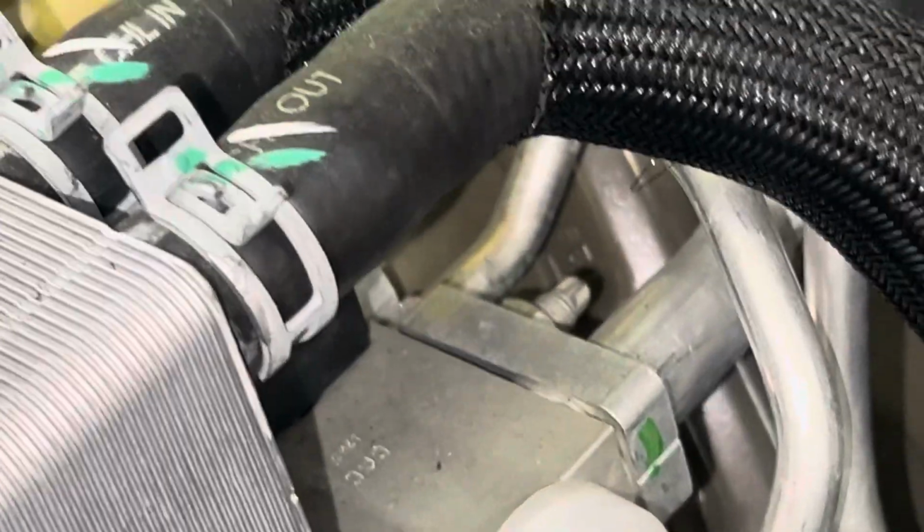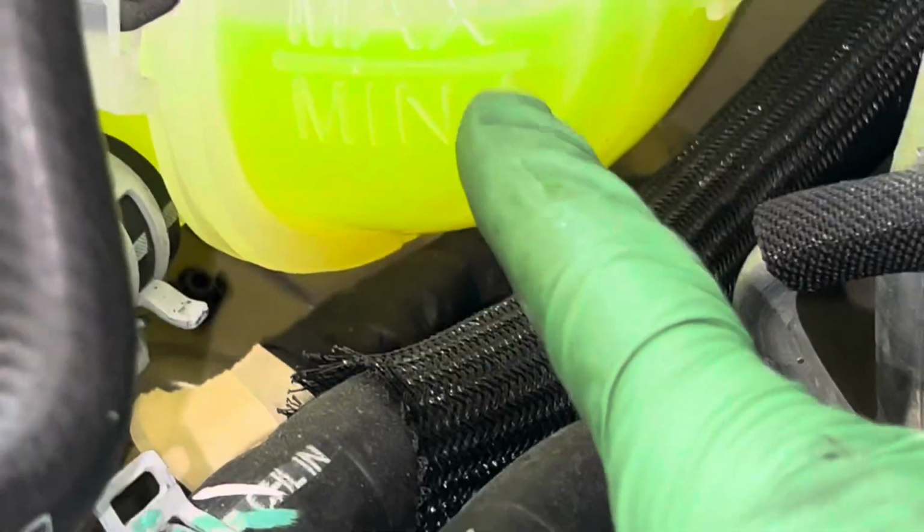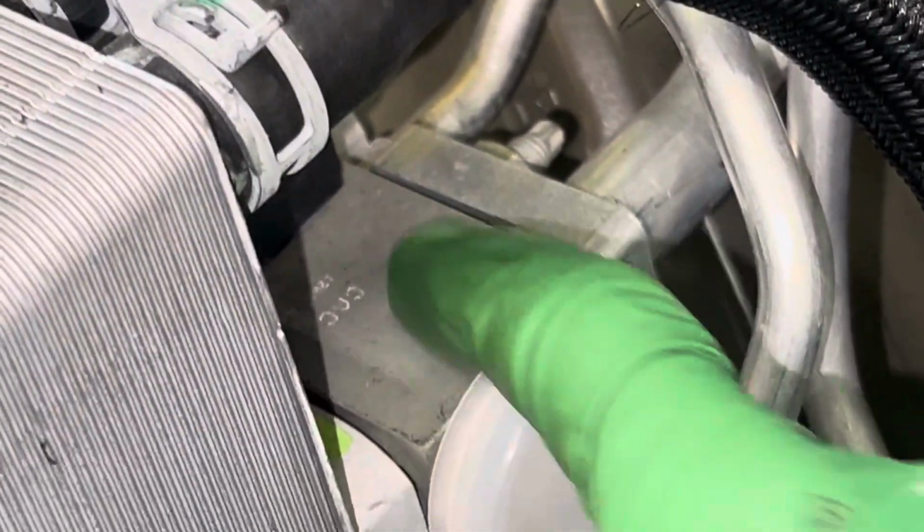So we're looking at a 2023 Mustang, and what you're looking at here is the glycol to refrigerant plate heat exchanger. You have the glycol right there, you have the expansion valve right there, you have the plate heat exchanger. All these little tiny fins that you see there, each one is a hollow plate, and between one, glycol will go down, coolant will go down one plate.